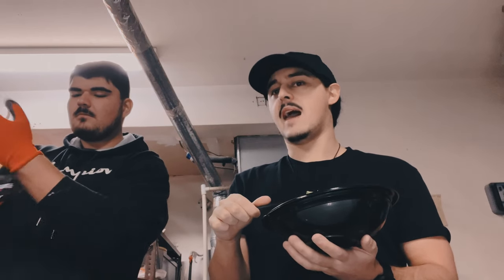In case you know and Hunter knows, but maybe the viewer doesn't know, Teslas have to have hockey pucks, which go into these little holes on the bottom of the car. So it's got like a piece and then a puck, and it clips in, and then you have to do the jack stand onto that. Be advised, don't just jack up your Tesla. Show them on the next wheel we do. You'll pierce your battery and set your house on fire.